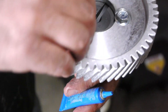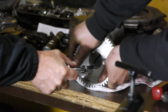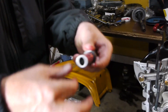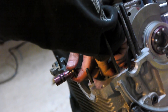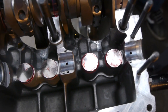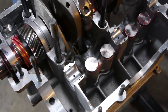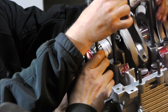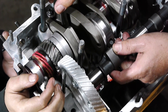The other big component inside the case is the camshaft. Geared off the crank, the camshaft moves the lifters up and down, which in turn is responsible for opening and closing the valves. The gears on the crankshaft and camshaft have to match up at a very specific point. This ensures that the timing of the piston strokes will match up to the timing of the valves.